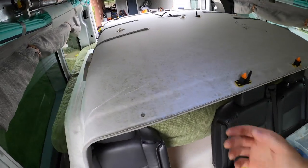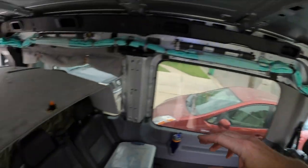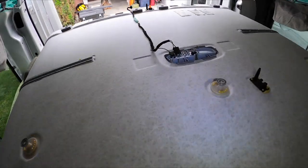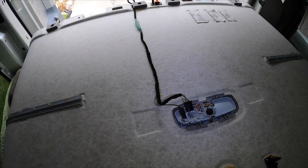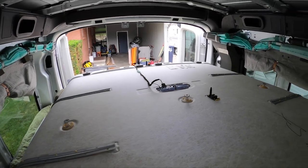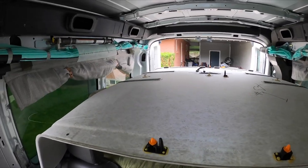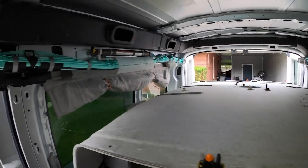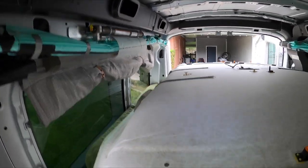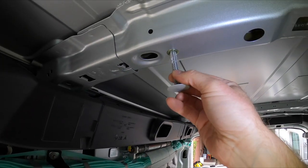As for what the inside of the headliners look like — this headliner is the one where this end connects here. You can see the back side of the light system. You just unplug the light cables from their plug-ins right here. The way these mount to the ceiling is with push pins — they usually go up through here, and that's what goes through this hole that I've now threaded.